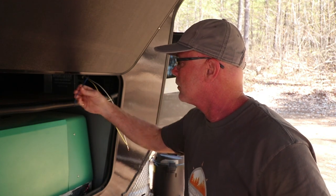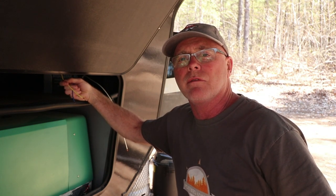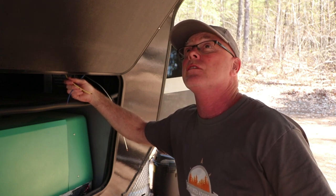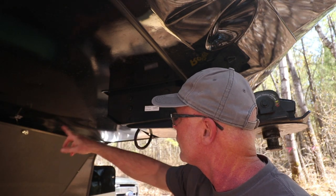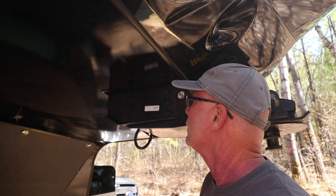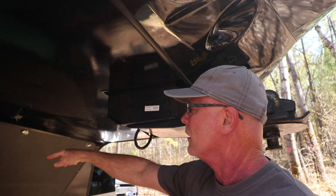Now let's get these wires hooked up. I have to route the yellow and the blue wire from the pump up to the pin box. The blue wire is the signal from the truck's brake controller, and the yellow wire will go to the emergency brake switch so that if the trailer detaches from the truck that gets pulled and it automatically applies the brakes. So I've got to fish these two wires — yellow and blue — up through the front of the trailer to the pin box from inside the generator compartment. I'm going to loosen some of the screws holding the underside cover on, then use this piece of rigid wire, shove it through along the very bottom edge avoiding the insulation, so I can pull the wires back through.